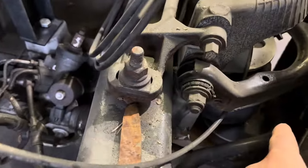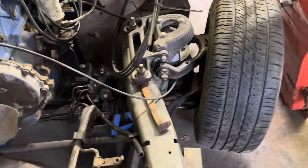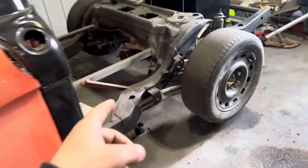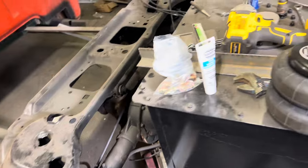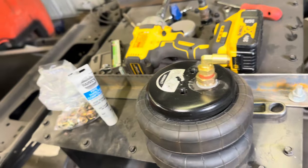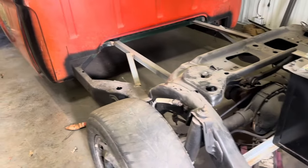I'll pull them all out. The bottom bracket — it's kind of hard to see — but the kit was way too big, so I'm gonna trim it up so it doesn't look like it should have been on another vehicle. We'll get all the airbags good to go, then I'm gonna set the box back on the truck, set the compressor in there with the tank, and get everything plumbed. If you guys are doing this, get the good fittings — stuff that swivels. It's so nice being able to move the stuff around and just snap your airline hose in.